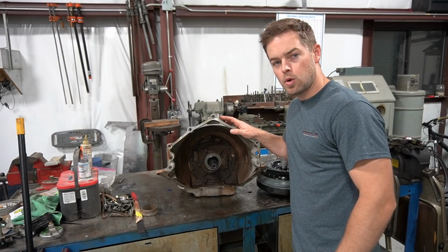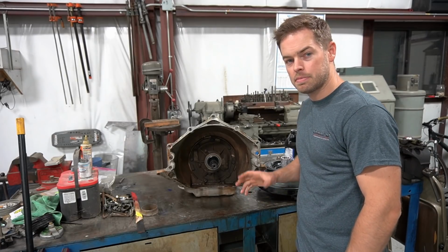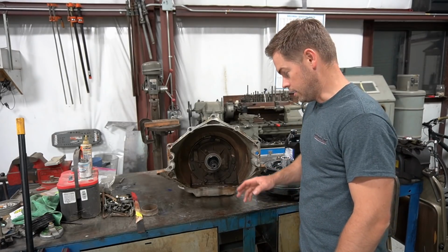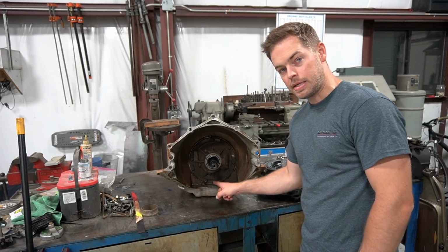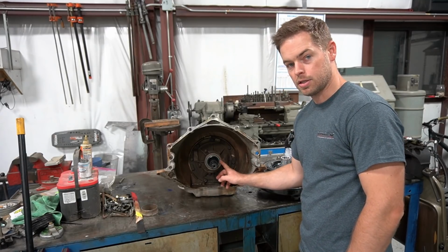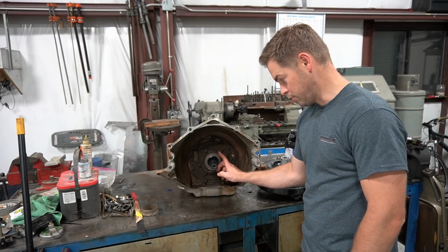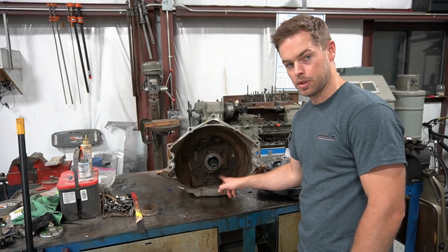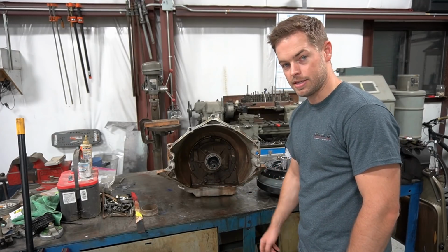All right, so I got about a quart of trans fluid stuffed into this converter here. Circle D recommends about a half quart or something to put in there. Either one's probably fine. This transmission looks like it was leaking around this pump seal or torque converter seal here, so I just went over to O'Reilly's and got another one. It was like $7. Hopefully that slows down this leak and quits dripping stuff down here and collecting greasy oil.